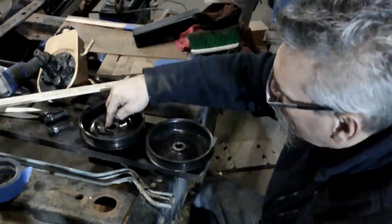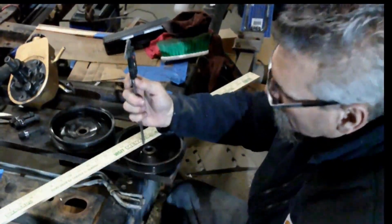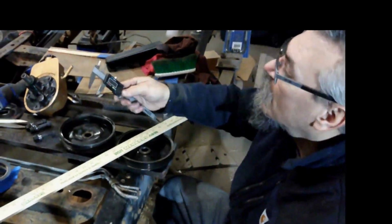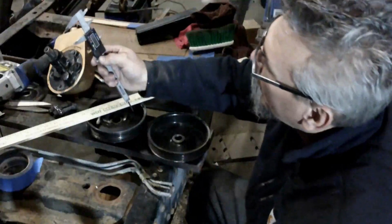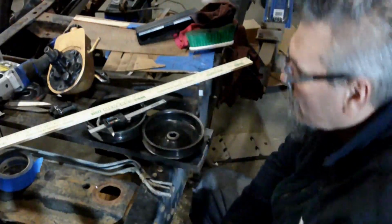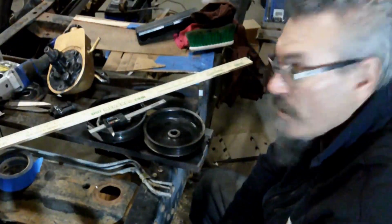And what I'm more concerned about is the back offset. Offset with the yardstick, 1.14 inches. And then we're going to offset, again, just counting the yardstick, just to get a point of reference. .917, so .92 versus 1.15. You can also see it's about a rib difference in offset. Just sitting here with the nose, they both have about the same nose here. This point, this is where you pull or push. So yeah, it's about a whole V belt groove off.